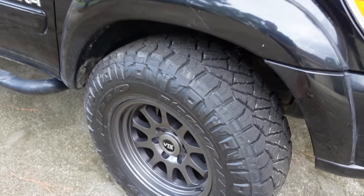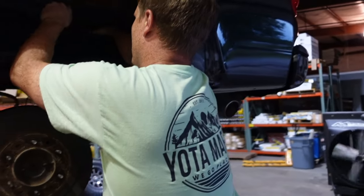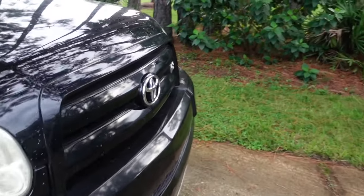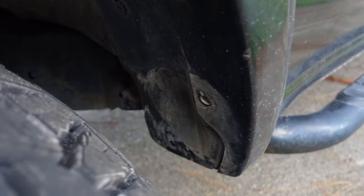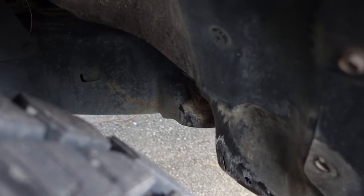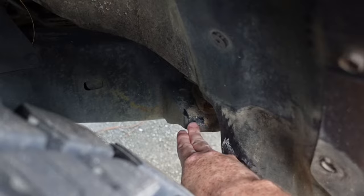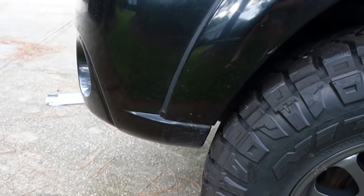It was hard not to pick Methods for this truck, because this was my high school dream truck. I couldn't afford it in high school, but they look so good in California with Methods on it. But these VTX wheels look great on this truck. Going over to the driver's side — you can see we're rubbing a little bit inside the fender well. I took off the mud flaps up front, and you can also tell we've been catching on the cab mount right there. That will definitely need to be cut back just a little bit, maybe hammered in. And up here on the front, just ever so slightly rubbing — we may just notch the front a little bit.